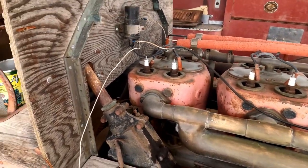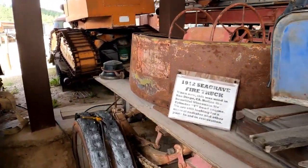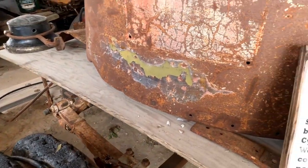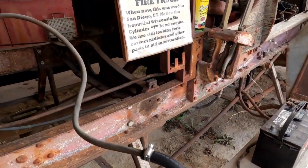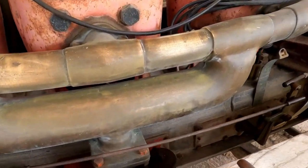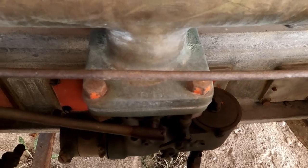So what we did is figure out how to get gasoline to this thing. We've got a hand pump and a couple of lines, and we just hooked that up to one of those lawyer gas cans they make these days and plumbed it into the fuel system of the Seagrave. We managed to get gas to this carburetor and then we stopped. So we're going to pump some more gas in there now and see if that carburetor holds or whether it leaks all over the place.